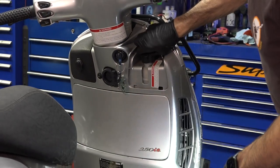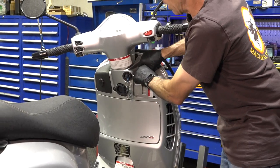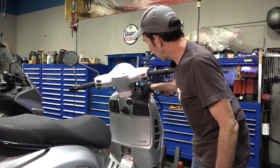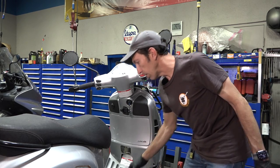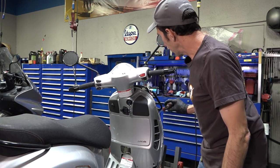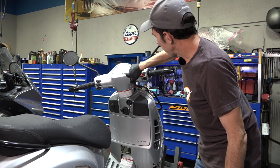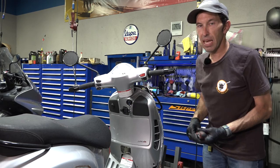It's not alarming to find the coolant a little bit low even when you don't see any dripping leaks. These Vespa scooters have two radiators and pretty much a dozen different joints for the cooling system — hoses with hose clamps. You get a small amount of weepage from those hose clamps under the floorboard. You've got several clamps, junctions, and the coolant tank all over the place, and they just lose a little bit of coolant through those, especially in hot climates.